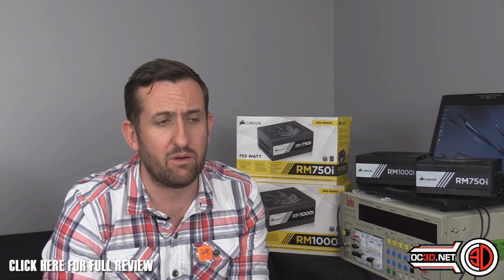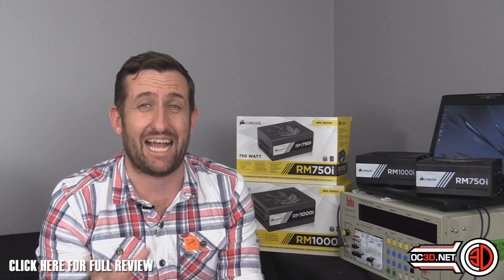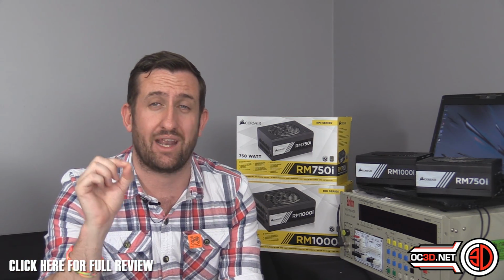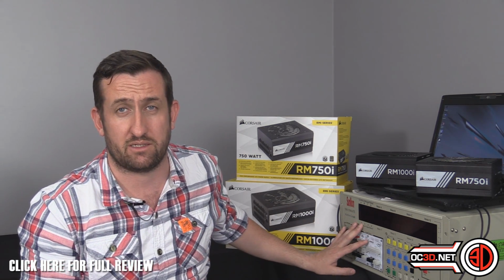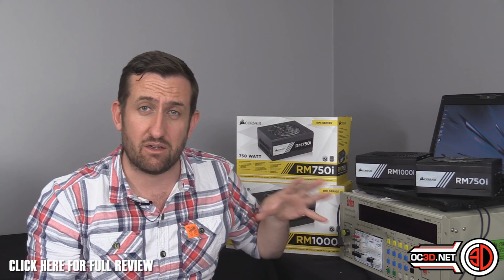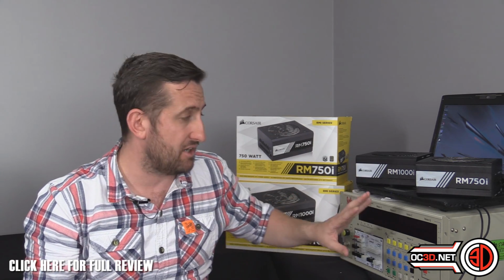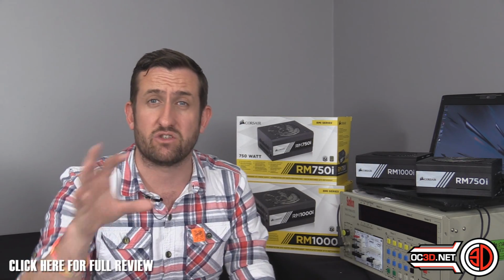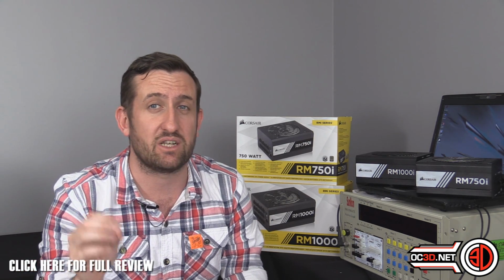That's a great feature because it simplifies things, and Link is actually really good. Later on I'm going to show you just how close Link is to a multi-thousand-pound piece of equipment like the power supply tester that we've got. Link is that good, it's within 1% of the actual test that we're going to be getting, which is brilliant for those of you at home, so that you can check on your system, the temperatures, the fan speed, maybe set some manual fan speed profiles, because you can actually do that now.